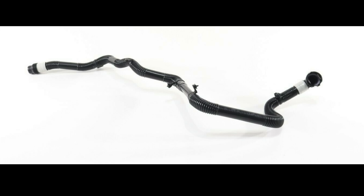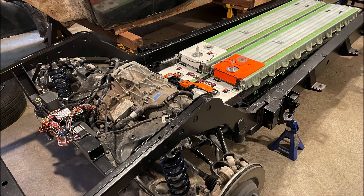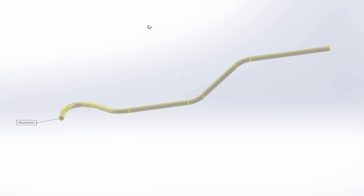To get the coolant around the car, I needed to make coolant lines. Tesla has these awesome plastic molded lines running around the car, but my setup is so different that I can't really use any of them. I could use one — the one that connects the inverter to the motor oil heat exchanger — but for all of the rest of them, I had to make my own hoses. I haven't yet found a place where I can send a CAD model and get a one-off CNC bent thin wall aluminum tube for any reasonable price. So in the meantime, I get to play Build a Tube.